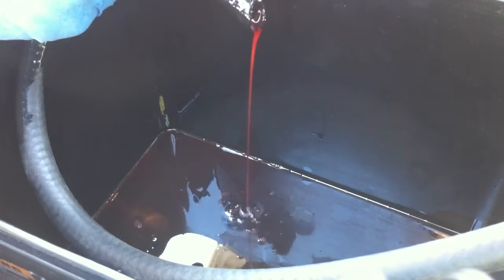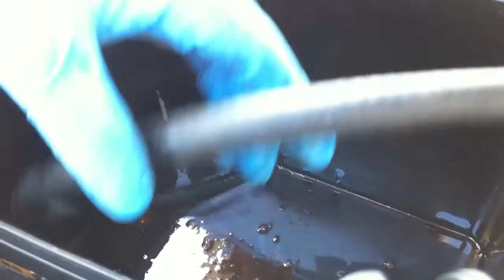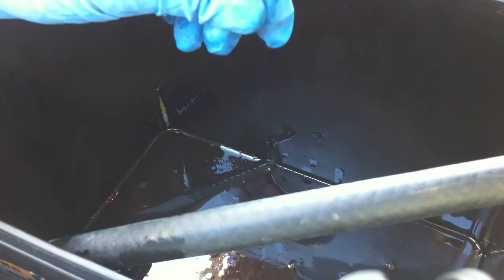We've been draining and replacing fluid — almost got a quart in. You can see it looks kind of like tomato juice now, not so much like motor oil anymore, so we're getting somewhere. This is where it comes in handy to have clear tubing — in a bucket like this it looks like diesel motor oil and you can't really tell what color it is. That's why clear tubing is nice.